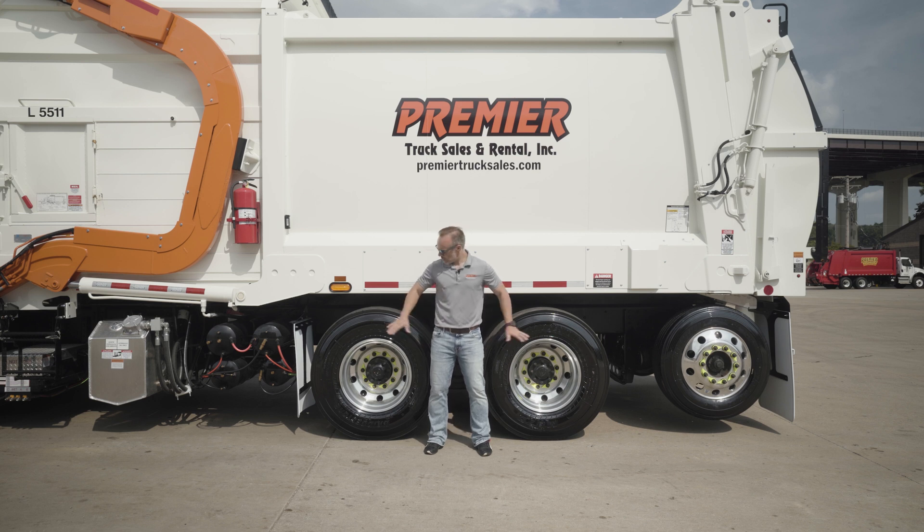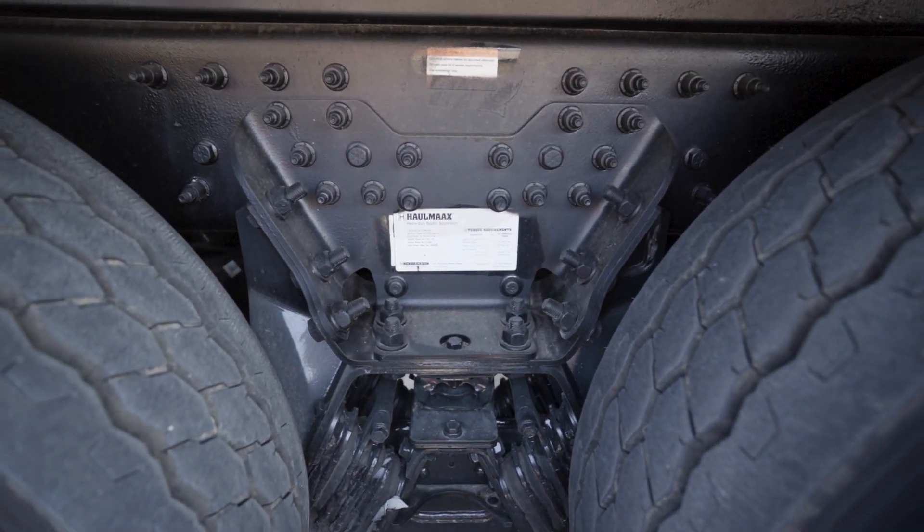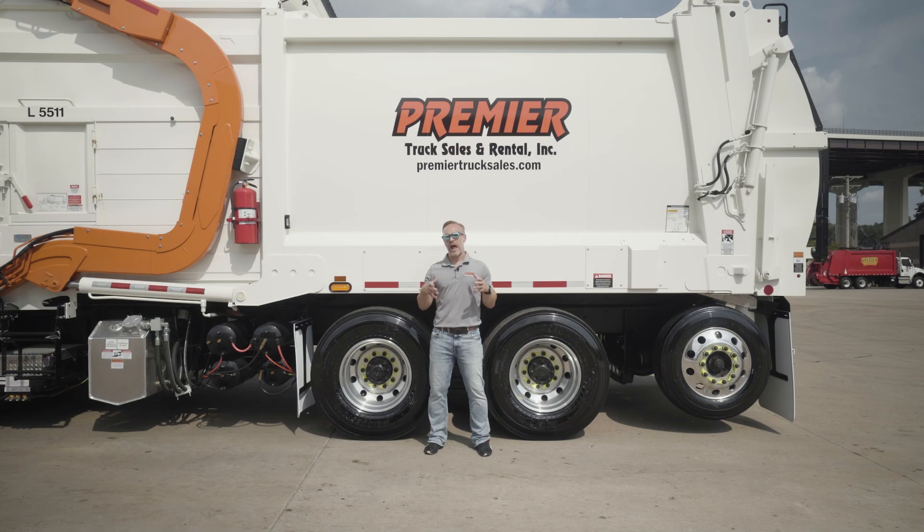Back here we've got our rear axle setup. These are set up on a 54-inch spacing on the HMX 460 suspension from Hendrickson. That is a great rubber-mounted suspension system that helps allow better articulation and a smoother ride without the truck giving that wiggly-wobbly feeling. Very stable, great articulation — that's pretty much everything you want out of a suspension. Part of that articulation is for traction; we want to make sure that all four of these points are on the ground firmly.